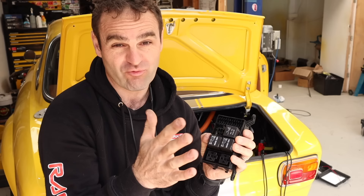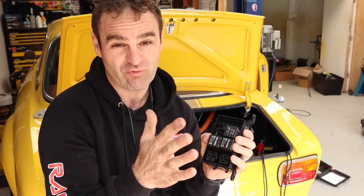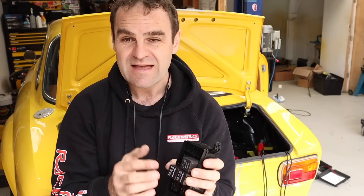Now I'm going to start putting in the rear relay box. To start with I'm going to put in three relays, because it's easier to do it now. I only really need one for the fuel pump — power comes in from the ECU but that wire is a little bit small, so I don't want to run power straight from that. What you do is this will switch on to main power — that's what a relay does. It's an electronically controlled switch, basically. So that can switch on bigger power going to the pump and I don't have to worry about too much draw coming through the ECU.